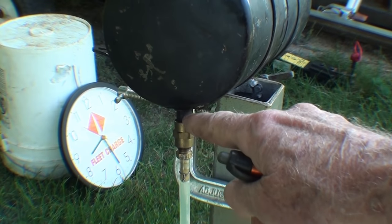It's going on nine o'clock. I have reinstalled the OEM gas tank, filled it full of gas. I've unplugged the other gas line and very little is coming out — it's wide open with no valves and it's pretty well clogged. Now I'm going to start the engine to see if there's anything wrong with the engine, which I doubt. The engine started instantly. There's nothing at all wrong with the engine — I'm pretty sure this myth is broken, but let's examine the evidence a little further.